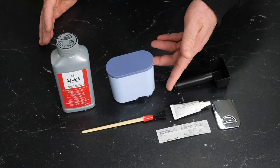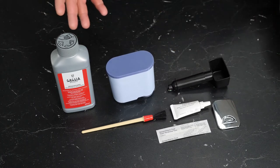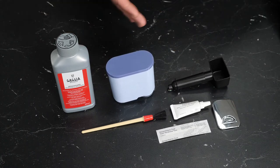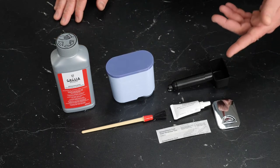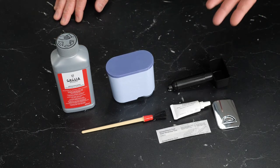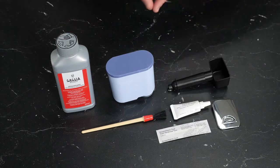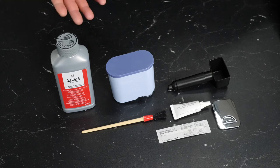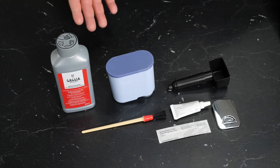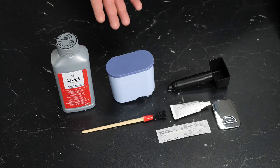Ahead of those, we have our brush — a handy brush for getting loose coffee grinds out of the inside of the machine or off of the brew group. Next to that is a tube of brew group lubricant. That's a food-safe grease applied to the brew group to allow the mechanisms to slide without friction. You'll want to apply this lubricant on a one-to-four month basis depending on your frequency of use.